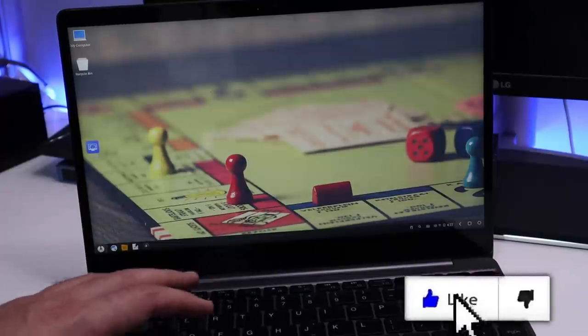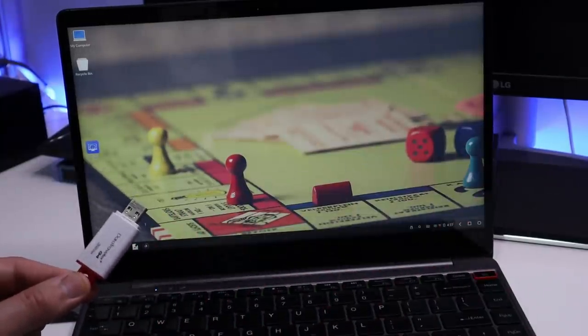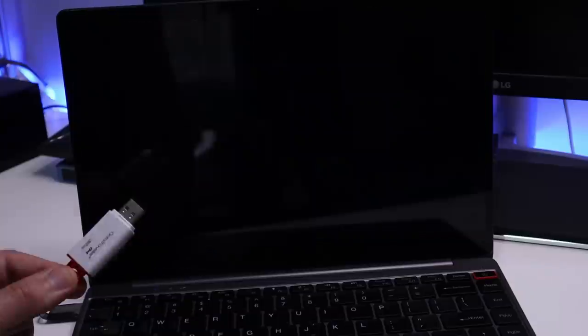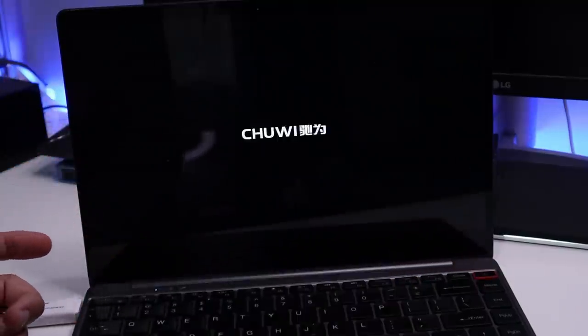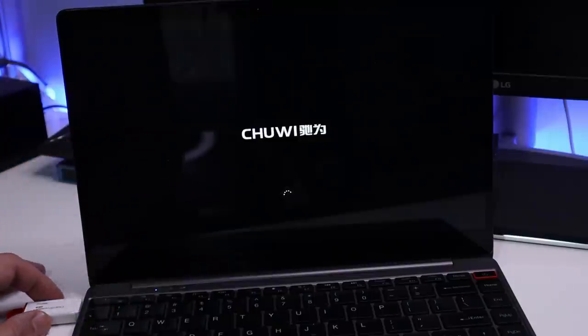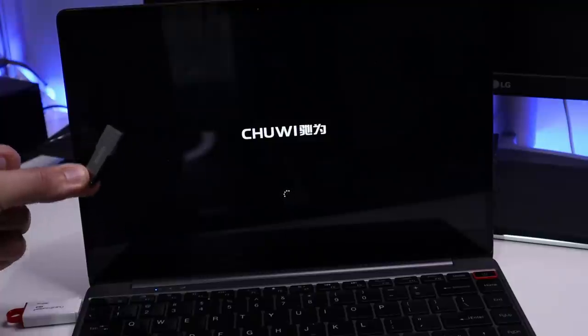Now one quick caveat - I've tested this about three or four times. Here I have a Kingston USB drive, USB 3, 32GB storage. I've formatted it a couple of times and installed Phoenix OS with the installer, but no matter what I do on two or three different laptops I just cannot get this device to boot. This shows it can actually be a USB drive that's not compatible. So let me plug that in - same laptop, same settings, only changing the USB drive - and we can see even on the same machine one USB stick may work and one may not. If yours consistently isn't working, try another one. I recommend these particular SanDisk USB drives and I'll leave a link in the video description.